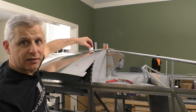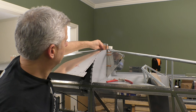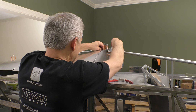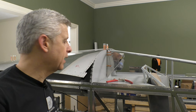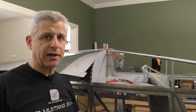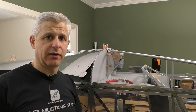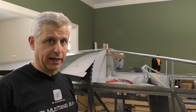You can see that the rail slides really well and even goes down this curve fairly nicely, which is exactly what it needs to do. That looks like it fits really well. So now I'm going to take it back off and match drill the holes from the aluminum straight into the nylon, and then go back and get the holes drilled into the turtle deck.